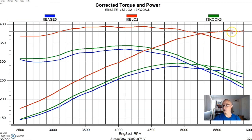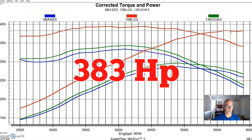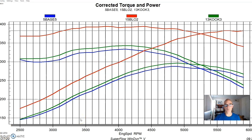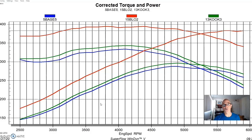Run with the supercharger, the power output jumped to 383 horsepower. The supercharger provided a peak boost of 6.8 psi, but especially at the top the boost level leveled off to four-and-a-half to five pounds, so it wasn't making a lot of boost. As I said, it was a non-intercooled version with an M90 supercharger, so there's only so much the supercharger could do.